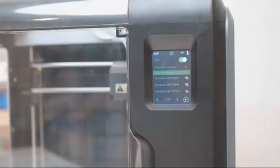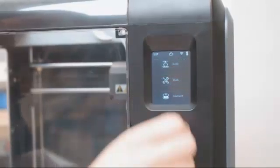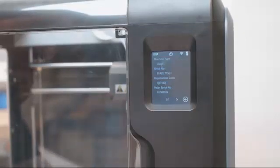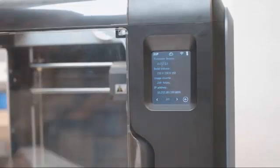Enter your Wi-Fi password if necessary and the printer should now be connected to the Wi-Fi network. If you prefer a wired connection, you're more than welcome to use the Ethernet port instead. Return to the home screen and select Tools, then select About. Locate the IP address on page 2 and write this number down for future steps.